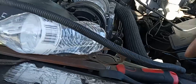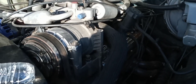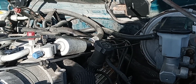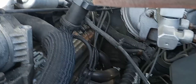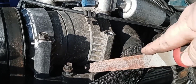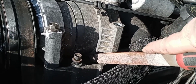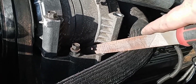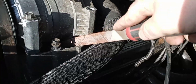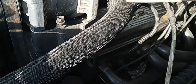I got a file — it's cool because it has the file on all sides, so there's literally no way you can't file something. What I plan on doing is going right here and filing just like this. I might be able to file this all the way through, but I'm doing this just to put a groove in it so that the cut-off wheel isn't jumping around.